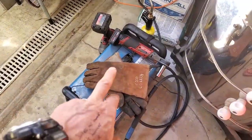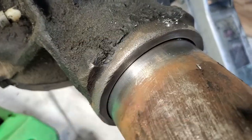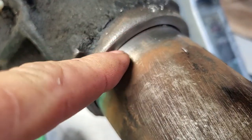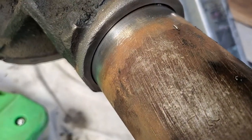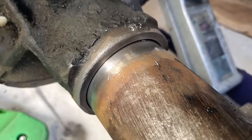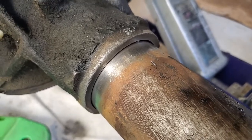I have two 220-volt machines and a Miller welder. Some people say you need to grind it off, but I might just take a MIG wire and run an incredibly small, tiny bead in that groove and then go over it with a 7018 as an option — just depends on your welding skills. Hope this helps, and thanks for watching. I am not a professional welder, so please take this as education only.